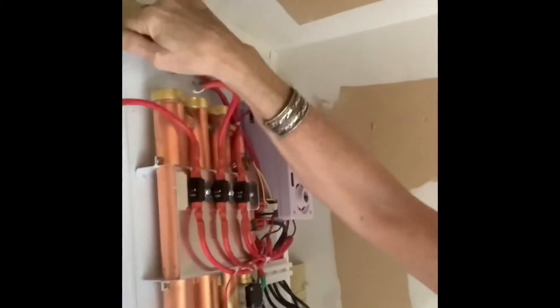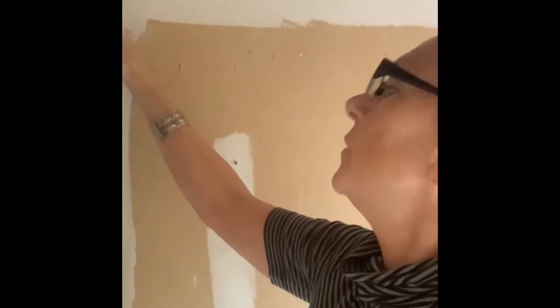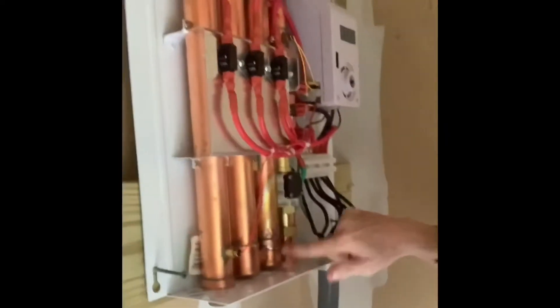I'm having to take the entire thing off. I already took these out and they are soaking. I had to replace one of them, but we're going to take the whole thing off because I've got to clean this cylinder right here. This is an addition after the fact, but I wanted to discuss the heating element that broke — it was sitting in the cylinder, stuck with mineral deposits, and it broke completely. I'll show a picture of that.